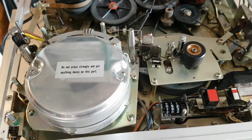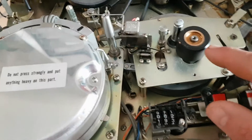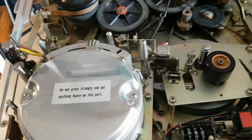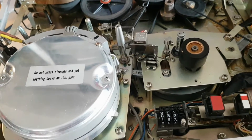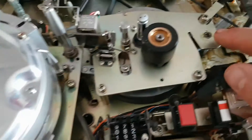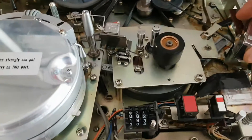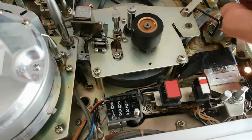I've come to a few understandings of what's going on. I've tried to lubricate the lever arm for the pinch roller so it can engage the capstan — I've lubed it a bit, it's moving a bit, but still it's still tight. I didn't have any spray grease so I had to resort to using WD-40. I also transplanted some grease onto the fulcrum there, but it still doesn't quite engage the capstan.